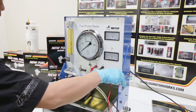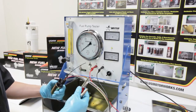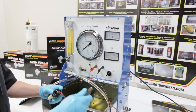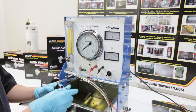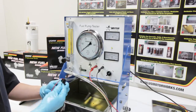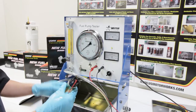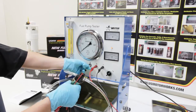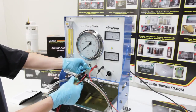After that, take your two power terminals and connect the red alligator clip to the red wire and the black alligator clip to the black wire. At this point, we'd like to run a dry test just to see if the fuel pump is functional. To do that, hold the pump out of the liquid and quickly turn on and off the power switch. If we see that the unit is running, we can proceed with the wet testing.